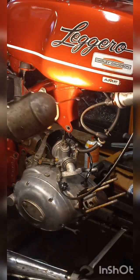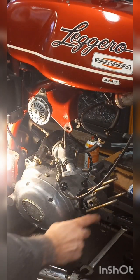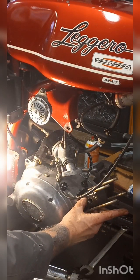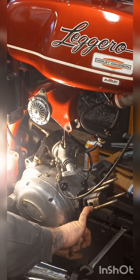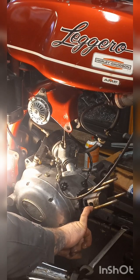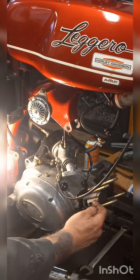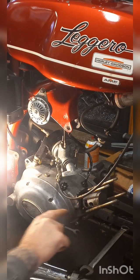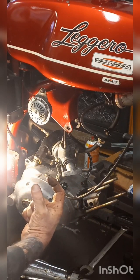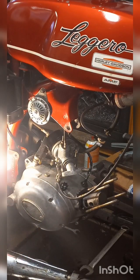There's two rings on this piston, only two. There is no oil ring. They are identical. And there's a little wire clip in the side of this piston, in this hole right here, you got to take out with a pick. Make sure it does not go flying. Put a rag down around the base of this piston so it does not go down inside your motor. Once you get that off, there's a little spacer tube that goes through it. You can slide that out and pull the piston off, which is what I'm going to do.